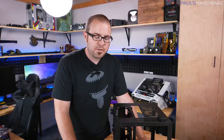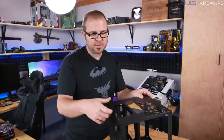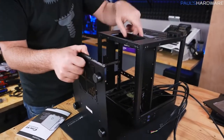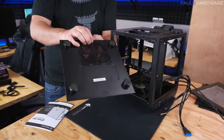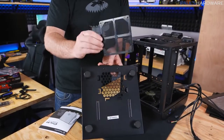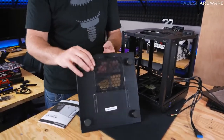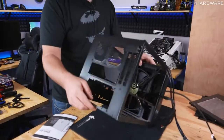There's also a newer USB 3.1 header that is different from USB 3.0, so if you want 3.1, make sure both your case and motherboard have that header. Unique to this case, aside from the two side panels and top panel, there are a couple of thumb screws that allow me to remove the bottom piece to access the chamber for the power supply. There's also a dust filter down there beneath the power supply so it can pull in air without sucking up too much dust.